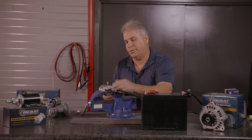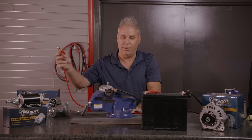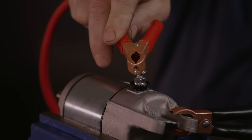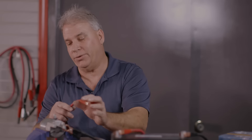Hook the positive cable to the positive post on the starter. This is considered the hot post — that's where your battery wire hooks to it on the ATV. Just touch it to it and you'll hear the starter running. You can hear it spinning, so you know you have a good starter; the issue is somewhere else besides your starter.